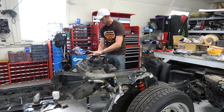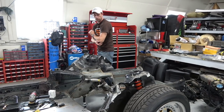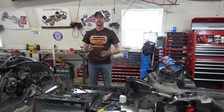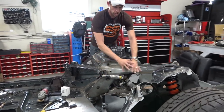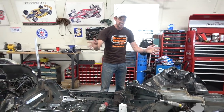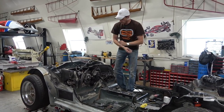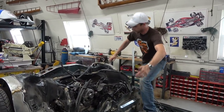It will still clear the bodywork at the top in the same way, but the floor and the bottom of the car will come up a little bit — probably only about an inch to an inch and a half. You'll also shrink up your cockpit area slightly, but your knees are right about here so you're really just shrinking the area for your feet. It's already an extreme and obscene car. I'm really glad these coilovers are going to work and we can use the uprights. I'll probably have to change the steering rack as well.